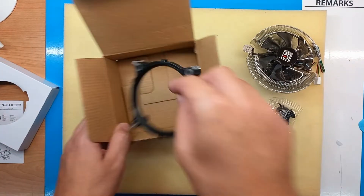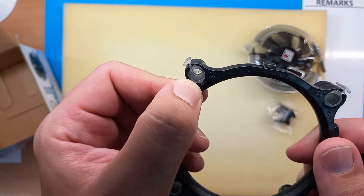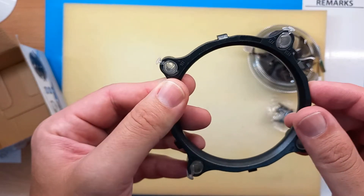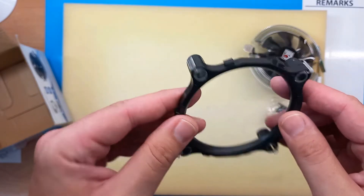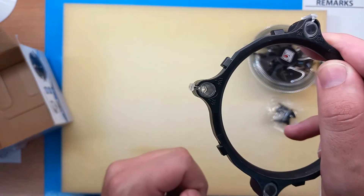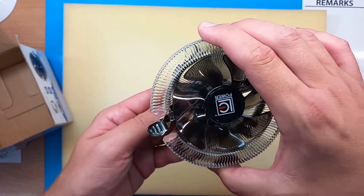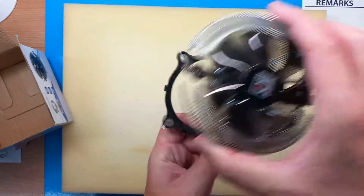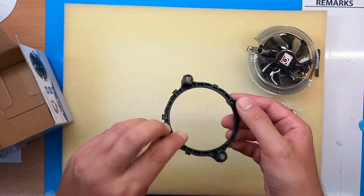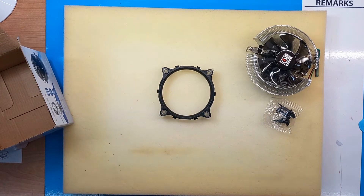Now let's look at the bracket. These are the plastic push pins and here is the bracket. If you look carefully, the mounting holes are not a perfect circle — they are more like an ellipsoid shape. This small wiggle room is how this bracket practically fits on all CPU sockets. A couple of millimeters of movement makes it fit on all sockets except LGA 1700. There are also different angles for placing the cooler depending on the socket you're using. I will also show you practically how to install it on a motherboard and CPU, so stay tuned for that part. Thank you and let's continue.